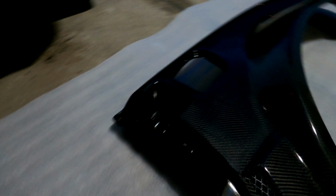These two holes right here, and that one and this one at the bottom, are the ones that are dimpled. The size bit I use for these is a 7/32, and all the rest of them I use a 3/16. I'll show you guys all the other ones over here. These are all pre-dimpled, so you can just go ahead and drill them, and I drilled them on the other one and they lined up pretty good. I haven't done the top ones just yet, but I will.